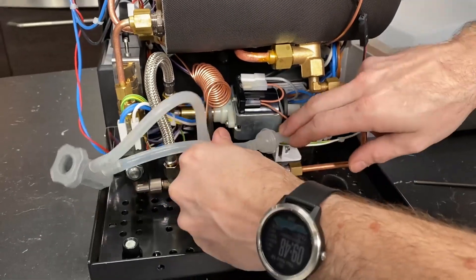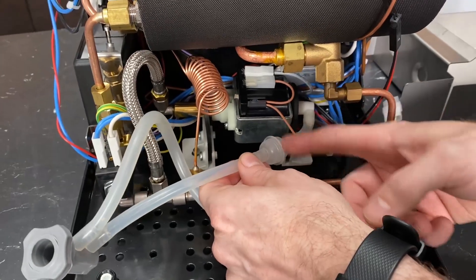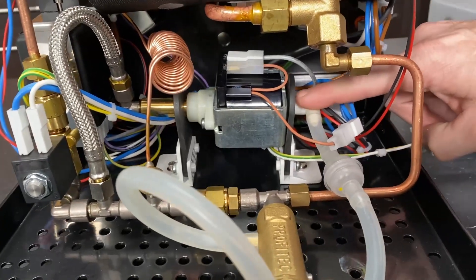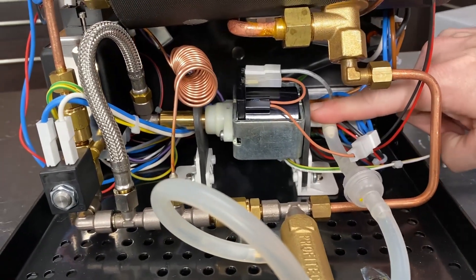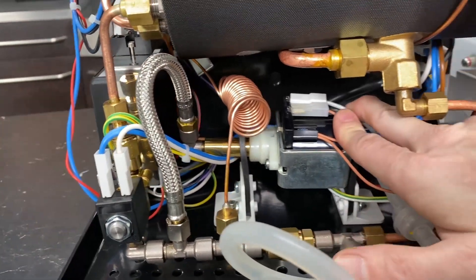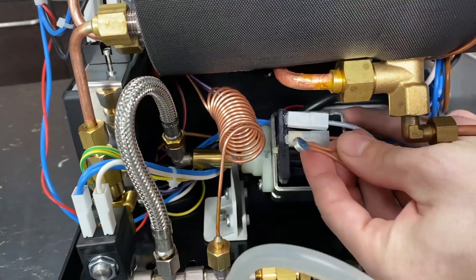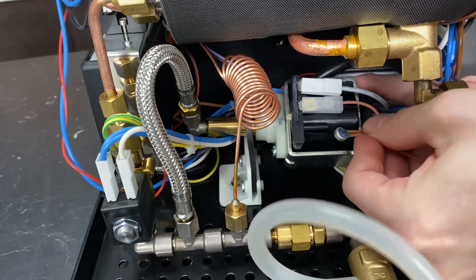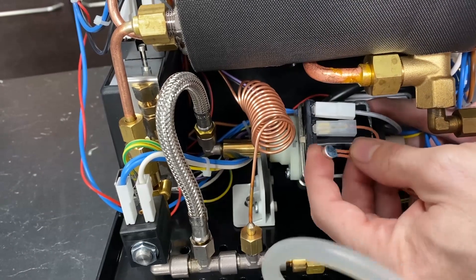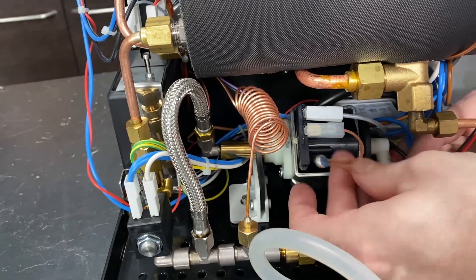And the bottom one, this is where the water is coming into the pump. For the pump, you have your in-line particle filter — it's just got a little mesh screen right in the middle there. After the filter, you're going to come into this little elbow on the pump. This is a vibratory pump. On the vibratory pump, you have your two wires for the power, and you also have this little limit here. If your unit starts to overheat for any reason, that will go bad — you'd have to replace it. You would disconnect here and there and just replace that whole part of the system.